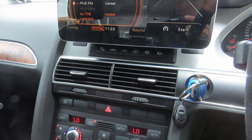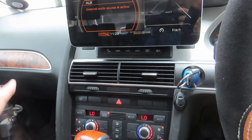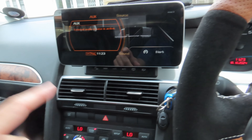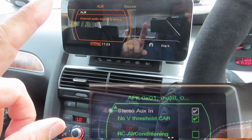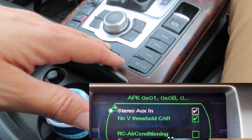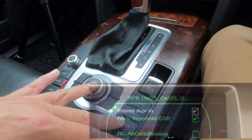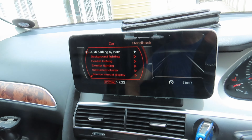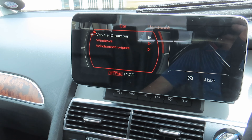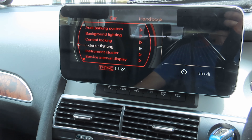When you install this system, you actually have to activate the AUX if you don't already have one in your car. You have to get into the secret factory menu and activate the AUX by making sure it's checked. You do that by pressing — I think it was the car button and the setup button and the MMI button at the same time. I've still got all my factory settings, so I can move the MMI down and set windows, windshield wipers, central locking, exterior lighting, ambient lighting.